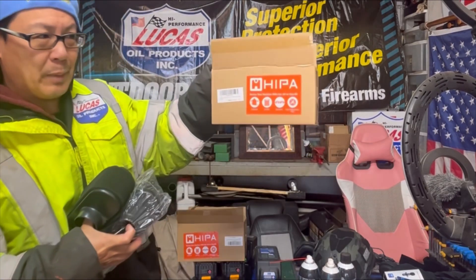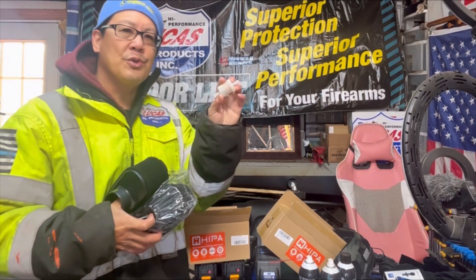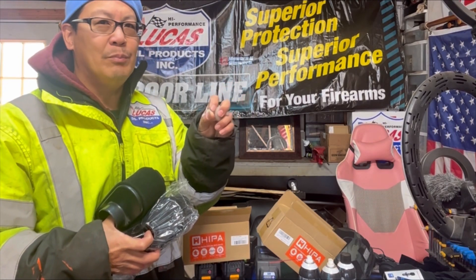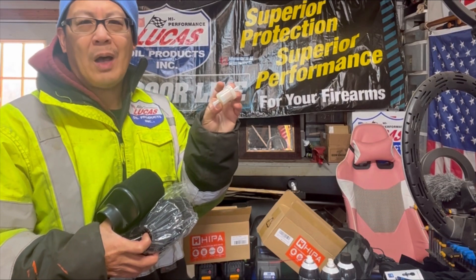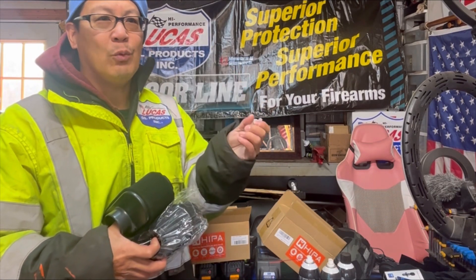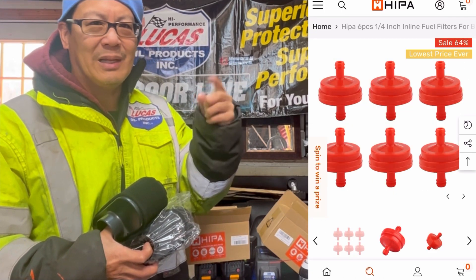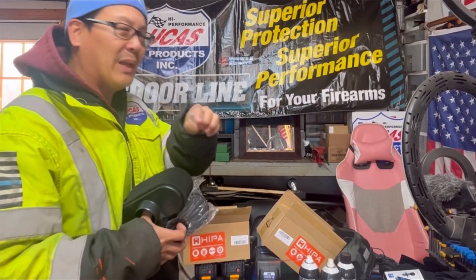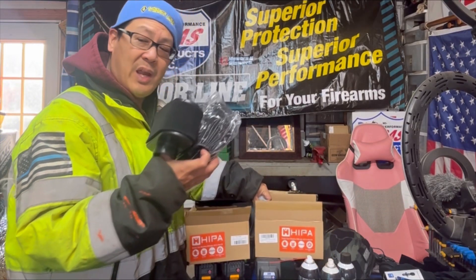They sent me two — one for each mouth of the two carburetors. They also come with a fuel filter, but these fuel filters are for fuel-pump delivery systems, not gravity-fed ones. Gravity-fed systems need more flow, and since these are paper filters, fuel won't flow freely enough. For gravity-fed you need one of those red or black plastic one-piece filters with a steel mesh inside that allows free flow. Since my fuel delivery is gravity-fed, not fuel-pump, I would use one of those instead.